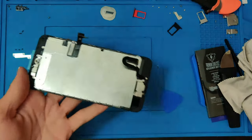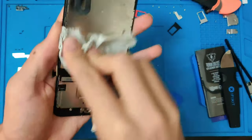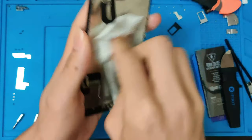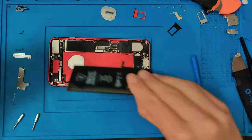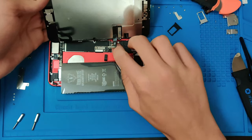And there we go — the home button is in. Go ahead and give it a quick clean just to get some of the fingerprints off. We'll be cleaning this up a little bit more when we've put the phone back together. We'll grab the phone right here and we're going to test it out. We have our new battery right here. Give everything a quick plug-in.